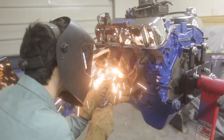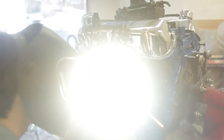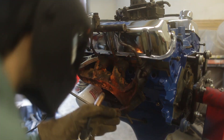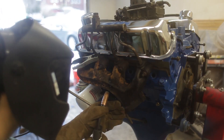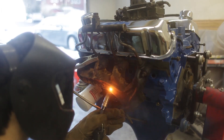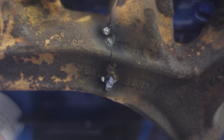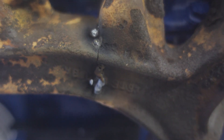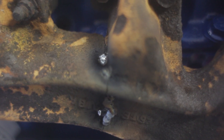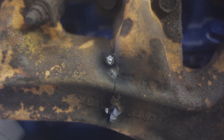Here's the fresh paint - that's a mess. As kind of expected, the rusty cast iron just kind of disappears as you weld and that's what all the sparks were from. The weld doesn't really melt into the metal, it's just on top of the seam. We'll take this off and hopefully it held enough that we can clamp it down somewhere not on the engine and then weld up the rest of it.